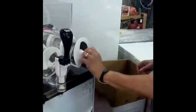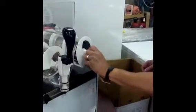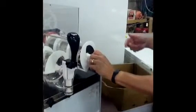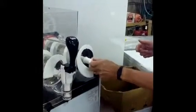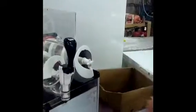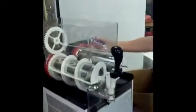As you're tightening this nut on the auger, how tight do you adjust it? You turn it until the auger itself starts to spin, and that is enough tension. The easiest way to put the bowl on over your red seal at the back is using a liberal amount of this lubricant on the inside of the bowl, and that enables easy assembling onto the back of the red seal.